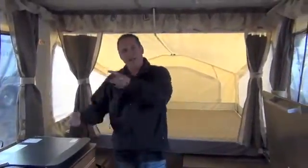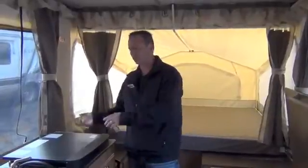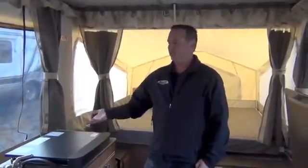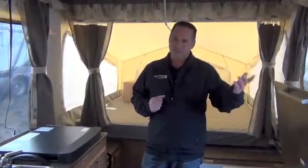And there's a lot of reasons why, but if you just take a few of these things I just told you and think about it, like one of the main brands that I go up against daily, you flip the galley over upside down. It means you got to unload it all. You got to put your stove on the ground. You just have one stove. It moves indoor-outdoor, not the swing level with the 3-burner and the outside barbecuer. We've got a 20,000 BTU furnace. They've got a 16,000 BTU furnace. We've got a 35 amp converter. This other brand I'm thinking of has a 25 amp converter.